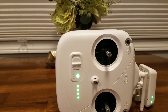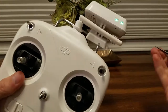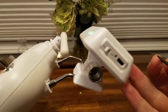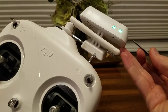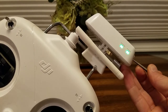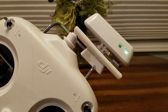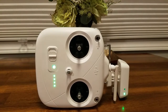Now it's a good distance away. The range extender has left the flashing mode and now it's into steady lights — it might be flickering for you. What we're going to do is a little reset on the range extender to put it into binding mode. I start holding it down and the lights come on and they go off. And once they're off, I can release here, and you're going to see this range extender is going to boot up again. When it boots up this time, it's going to be in binding mode.